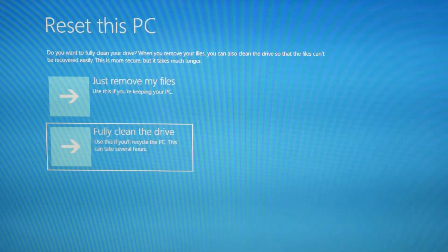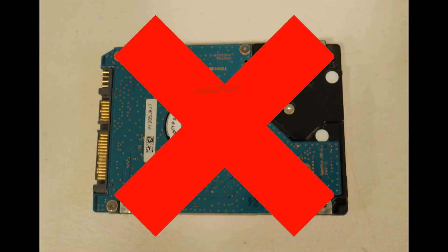Finally, if all these things don't work — resetting or installing a fresh operating system — and you've tried both and it still doesn't work, it could be that your hard drive is dying. By the process of elimination, we've figured out that's the last option. You might want to try installing a new one. Whenever you're replacing these kinds of components, you could view it as an opportunity to upgrade to a solid-state drive or a larger hard drive. That would be the last step in the troubleshooting method.